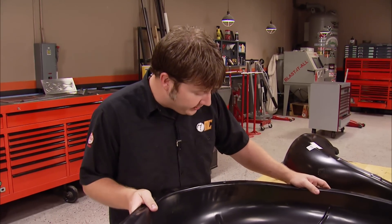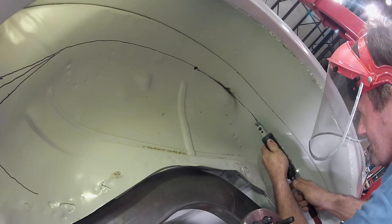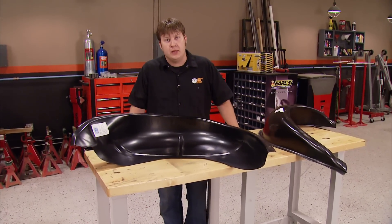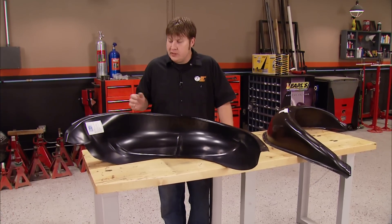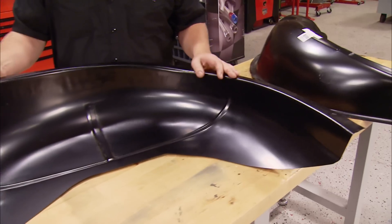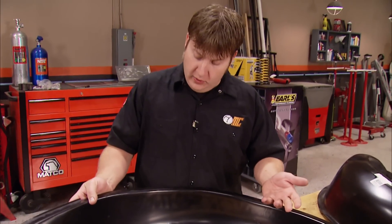Mank's got our factory wheel tubs whittled out of our Oldsmobile, trying to make room for those big wheels and tires. So it's time to start putting some metal back in it. There's a really good reason Mank left a stock lip on the inside of the wheel well — it's going to work as our attachment point and widen out the tub at the same time. Some guys opt to fabricate a set out of plain flat sheet metal, but that usually involves quite a bit of fab time. In our case, there's no real reason to reinvent the wheel. Another route is to get a set of stock-style pre-stamped tubs like these we got from Year One. If you're doing a factory restoration with a bit of rust in your tubs, these work perfect. Or in our case, with a little bit of modification, these things can save us a boatload of time.